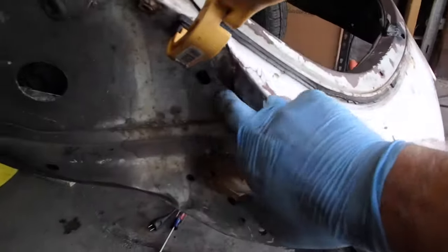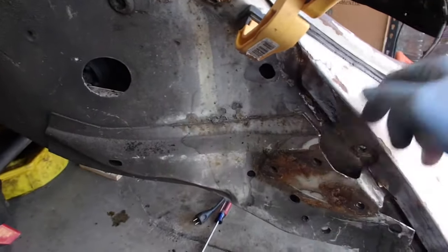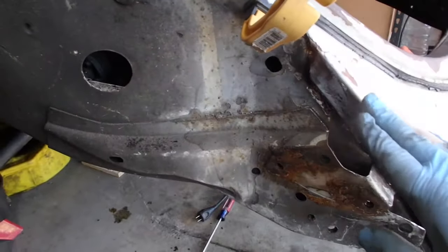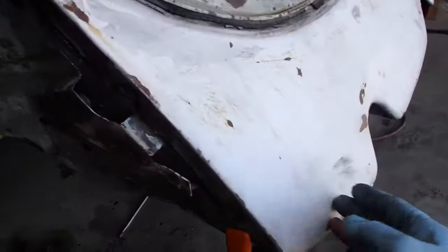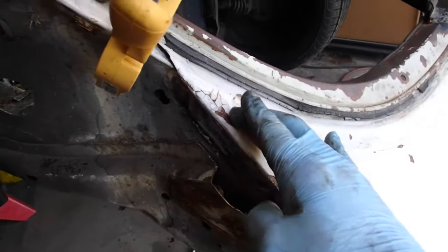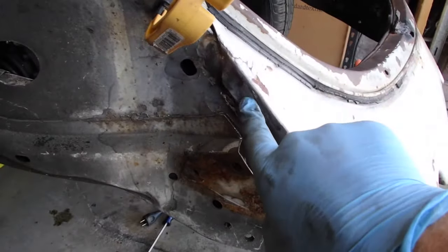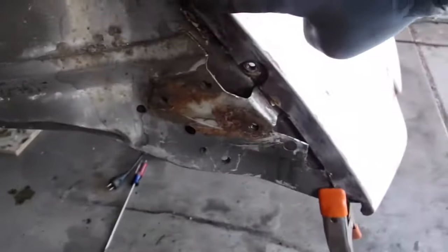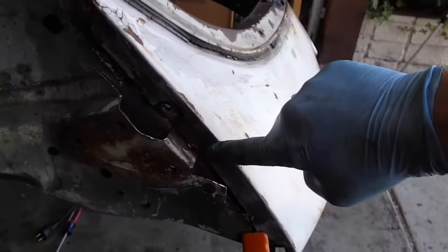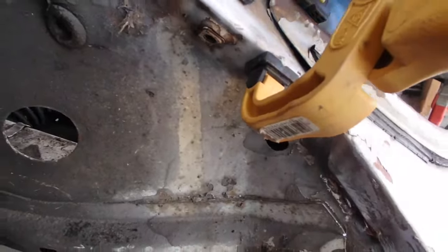Okay, so this part of the rear quarter is double skinned. Through there, there's another skin on the other side. So if you come up underneath here, you can get all the way up to about there. So I'm thinking nut on this side, bolt on that side, bolt there, bolt there, bolt there, hold it nice and firm. I may even look at up here.